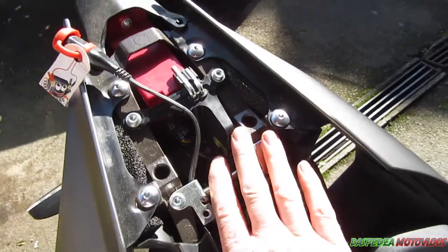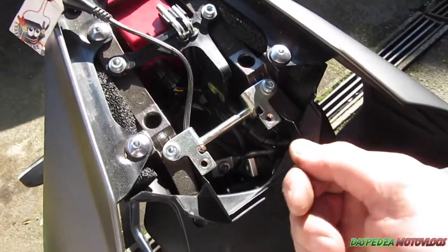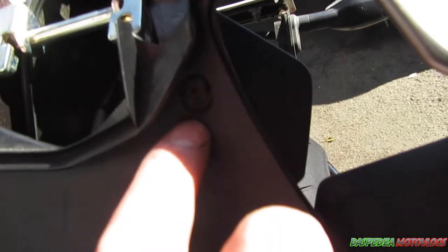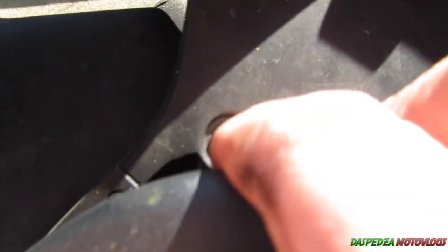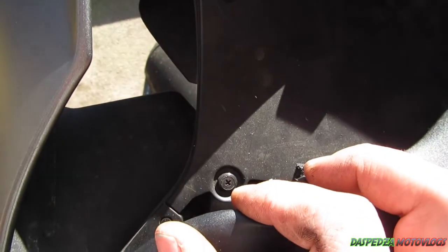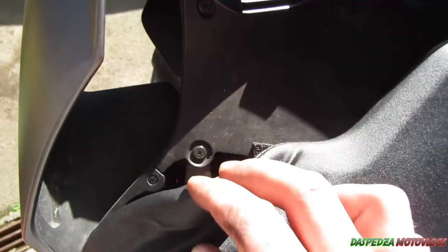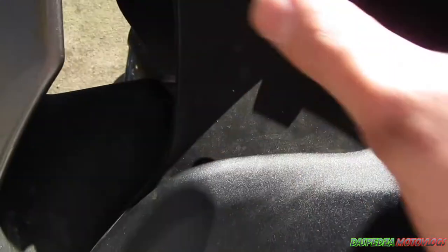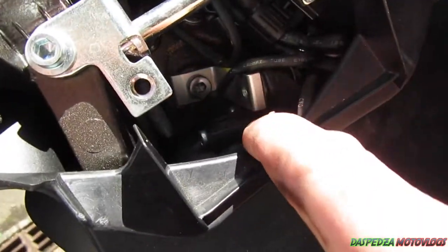Once you remove the rear seat, which is pretty simple — just stick your key in — down in here is that servo I'm talking about. You don't actually have to remove the rider's seat to get to it. What you want to undo is that one, that one, that one, and that one. You undo these with a small Phillips head screwdriver — they're not conventional screws, they're actually trim clips, or 'scrivets' as they're known.